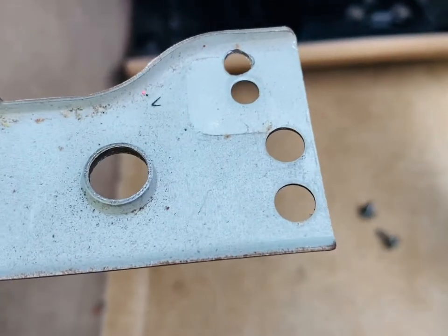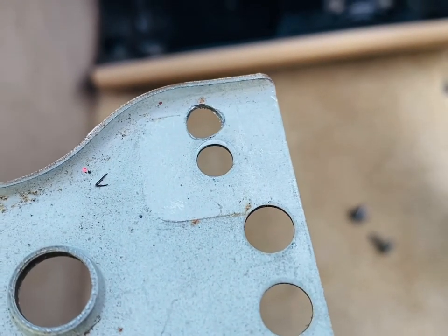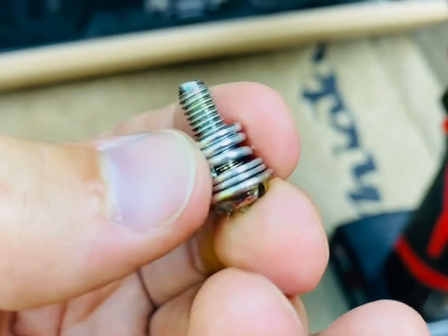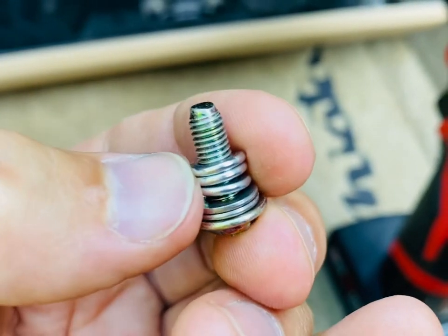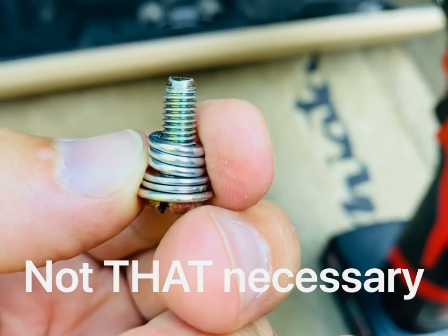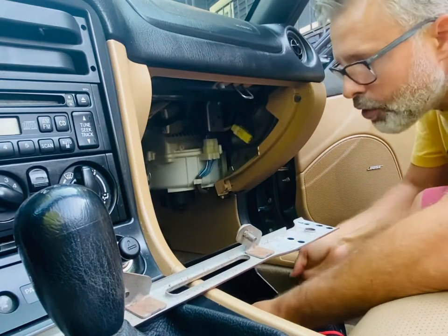As you can see, I drilled a second hole there, and that's the new hole that the brass screw is going to go back into. I also grabbed myself some washers to be used as spacers for the brass screw. That's going to be necessary to get the right adjustment on the glove box. Now we're just going to put things back together in reverse order.